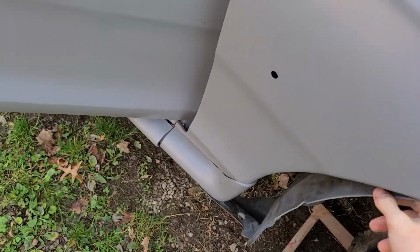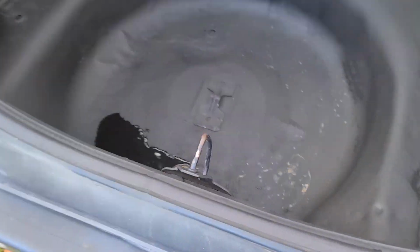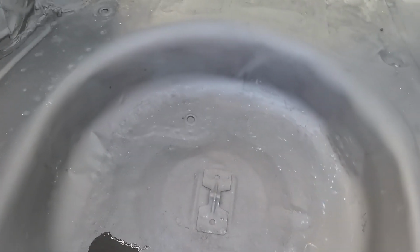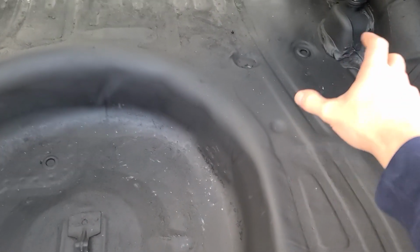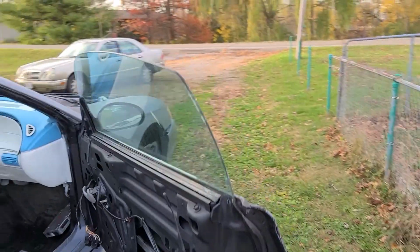And you see I have the plastic off to be able to do that, all the way back under the car. Get those self-tapper hangers, zoop, from the back, and we have our hole right there. 22-gallon alcohol compatible fuel cell, Walbro 300 LPH right there, and we'll just route the return back through there. So that'll be good.